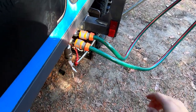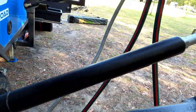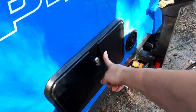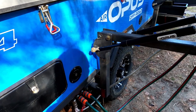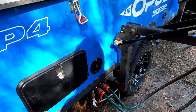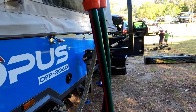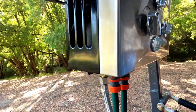This is it hooked up. This is your shower tank and that feeds into the water inlet, then this goes into the cross feed. This is the water out and it goes into the cross feed which will feed the shower, giving us hot water from the shower. It also goes across the camper to the second outlet on the kitchen side, so once we hook that up we'll also get hot water to the sink. As long as the gas is on and the igniter — this little button under here — is on, as soon as you start to run the tap it'll click and then you get hot water.